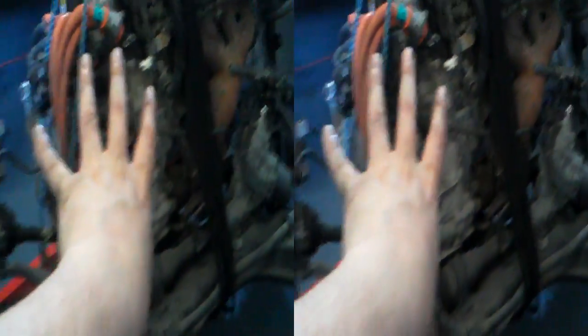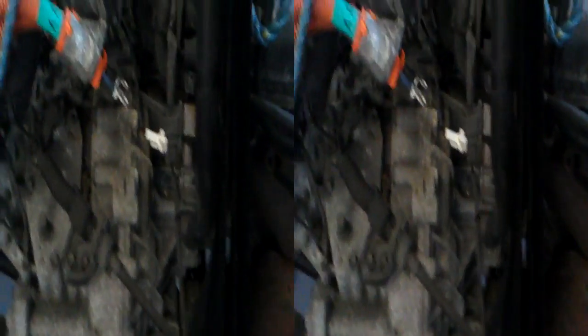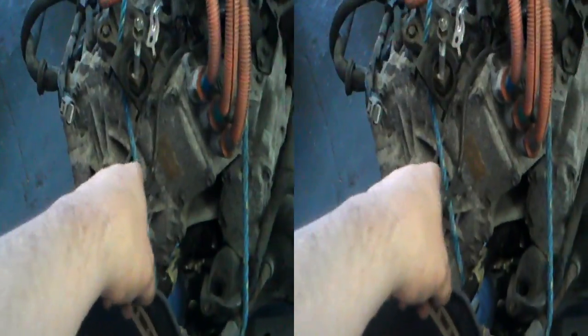So if anybody wants a Prius engine — I'm not sure if it works or not. But as you can see, the bit that we actually want isn't that big — that's the joined bit. All of that chunk there is only going to go and you're going to have an empty space. Behind here, that's where the differential is. And this is the epicyclic gearbox that connects the two motors and the engine together. We're going to be separating that out. We have the main motor here — this is the drive motor on this side, which actually connects directly to the differential. So we'll be keeping that.